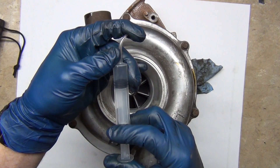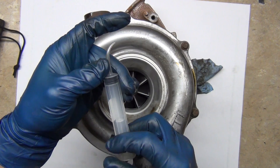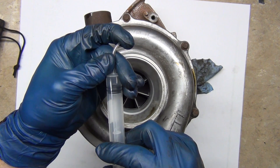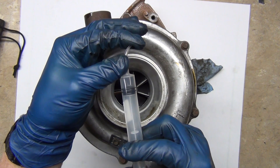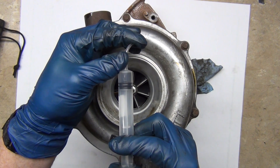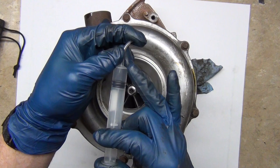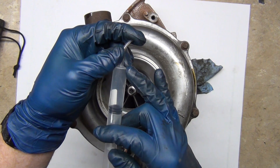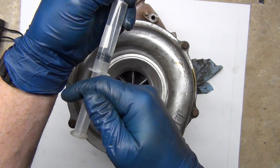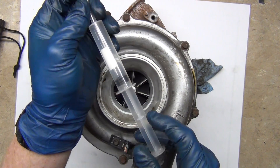When you squeeze it, it'll go puff. I wish you could see through a thermal camera — it actually superheats that air. That's the principle that diesels fire by. They get air all squeezed to the top and then squirt in high-pressure diesel — because this air is already high pressure, it doesn't want to be there. They squirt diesel into that and bam! It shoves the piston back down at the same time that the crankshaft moves around and the connecting rod moves around, powering the crank.